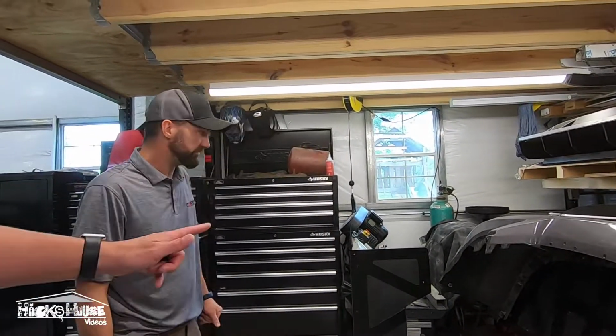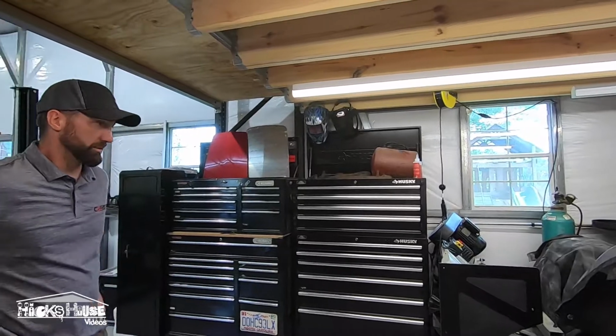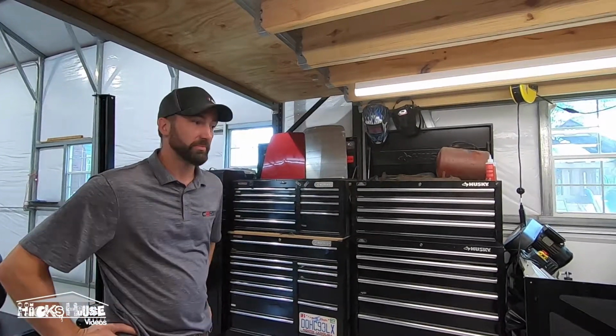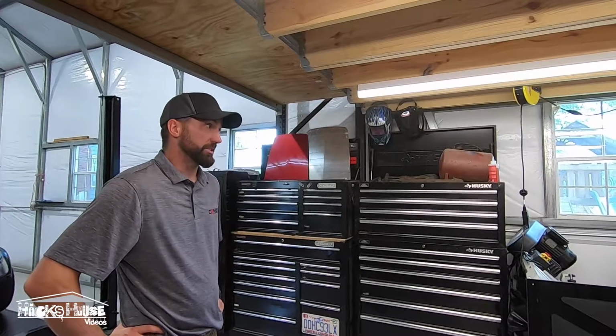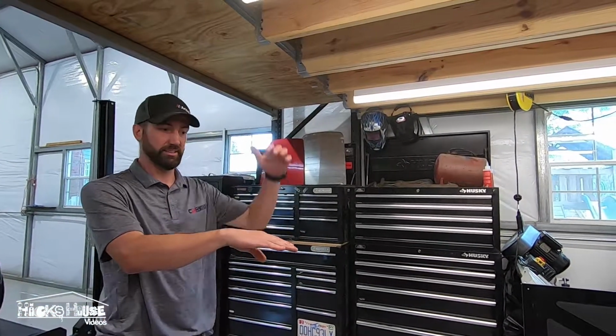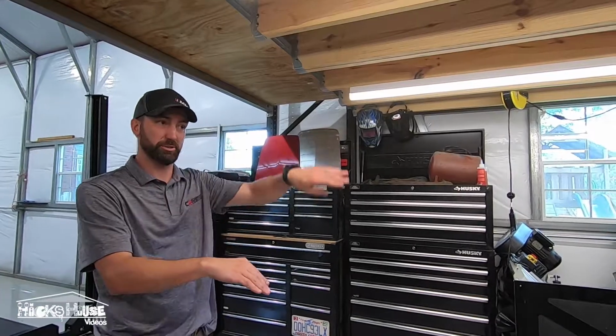What's the material that you use for your splitter? I don't know if we've covered that yet. So it's aluminum composite. So think thin sheet of aluminum top and bottom with a solid plastic core. I'm sure it makes it tougher than just plastic splitters. Yeah. And I started out making them out of ABS plastic, but ABS has pretty big thermal expansion. So basically, you park the car out in the sun, the top heats up, and the splitter picks up a warp.